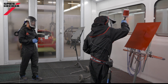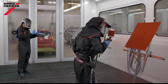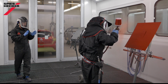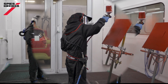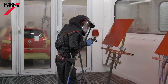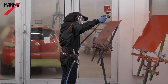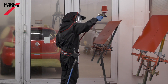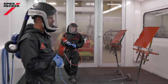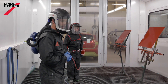We have three panels here. We apply the base coat on all three panels to hiding, and we do this because we want to ensure that we have identical applications later on, also on the car. That's the reason why we have larger panels — we can also use an old car panel to do that. The base coat application is finished; we flash it off now, and I'm coming back with the clear once they are dry.